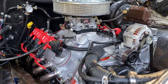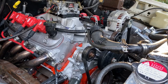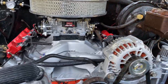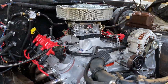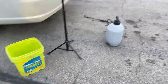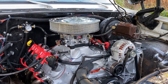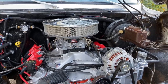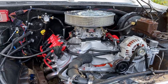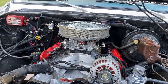It gives you just enough time to spray your motor off and clean it. I highly suggest it — once your motor is fairly clean and still has that top layer of grime, spray this acid on there and use a pressure washer. Holy man, it works really good on all types of aluminum. That's my quick tip. We spray it using a pump weed-killer bottle — you dilute it with water and it works amazing. It just makes everything look so much cleaner. Bare aluminum is so hard to keep clean, and this stuff is pretty great.